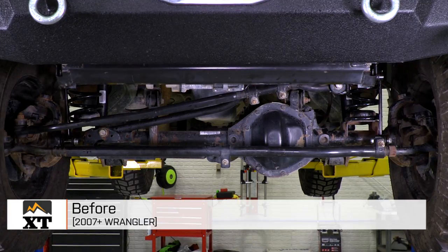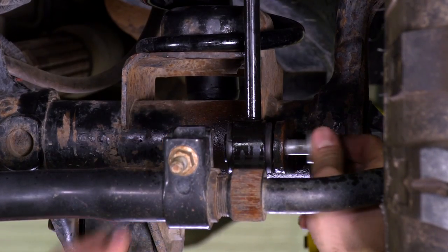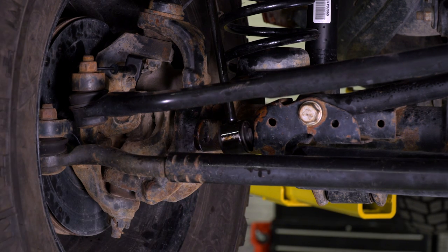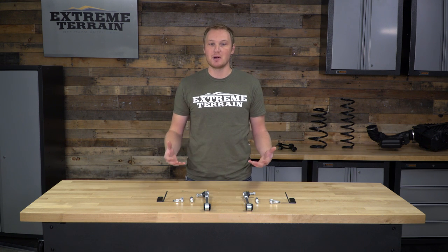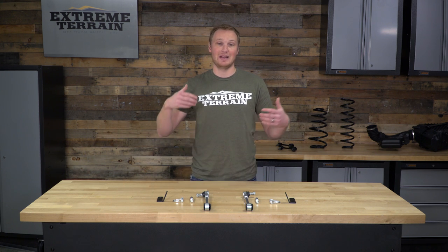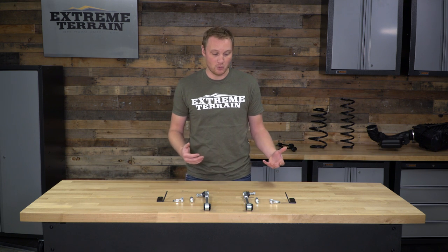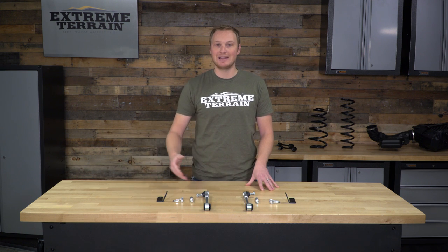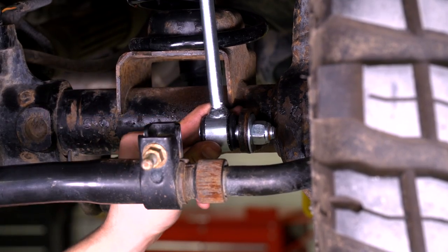You can certainly disconnect a factory front sway bar, but you're going to have to have some tools on hand, and you're going to have to have some bungee cords or zip ties to keep that sway bar up out of the way, so it's not going to bind up in the suspension when you're on the trail, causing you to bend something. What this kit allows you to do is have your sway bar links connected with a very quick and easy to disconnect pin, so that you can, in the parking lot before you hit the trail, pull the pin, disconnect the sway bar, swing the links up out of the way. The kit also includes a spot to store those links, so you can pop them onto this bracket, making it very simple to disconnect and then reconnect your sway bar.